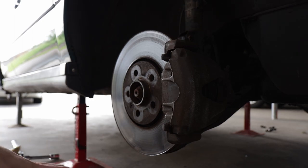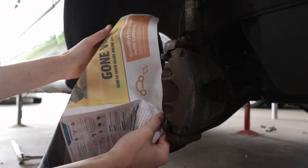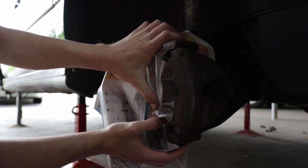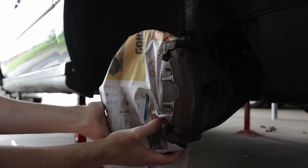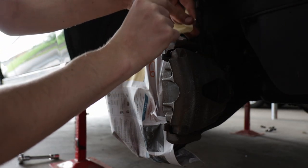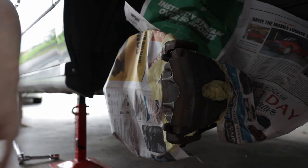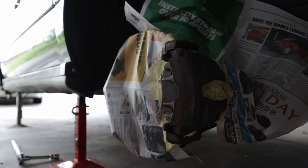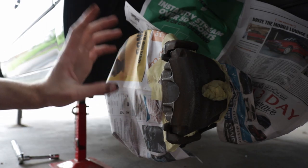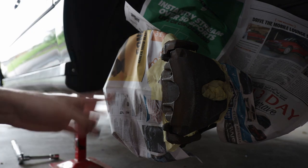My neighbor has now decided it's the perfect time to cut the grass even though it's raining. It's time we mask up the calipers — it's pretty self-explanatory. All we want to do is cover as much surface area as we possibly can and just leave the brakes exposed. I'm going to cover it like this, then tape that back, and fill in all the other points we haven't hit yet. There we have it — that's pretty much as much of the caliper as we need to mask up. We'll have no overspray onto any components we don't need to paint. We don't really need to paint the back of it — we're not going to see that. And as much as it is a pet peeve of mine painting the back of the pad, I'm going to do it here because I don't think these pads are going to be on the car very long. So let's repeat that for the other three corners and then we'll start painting the calipers.